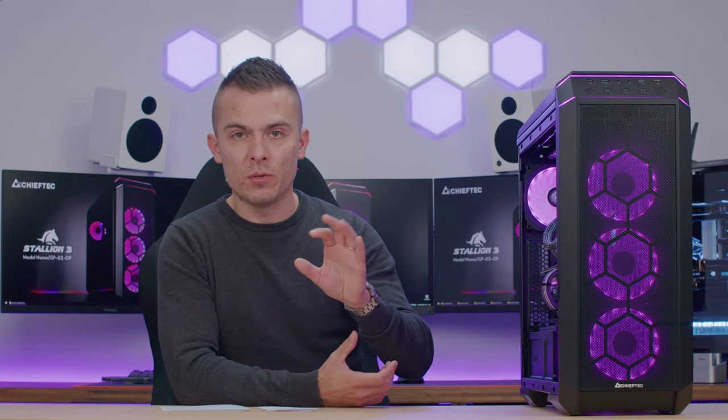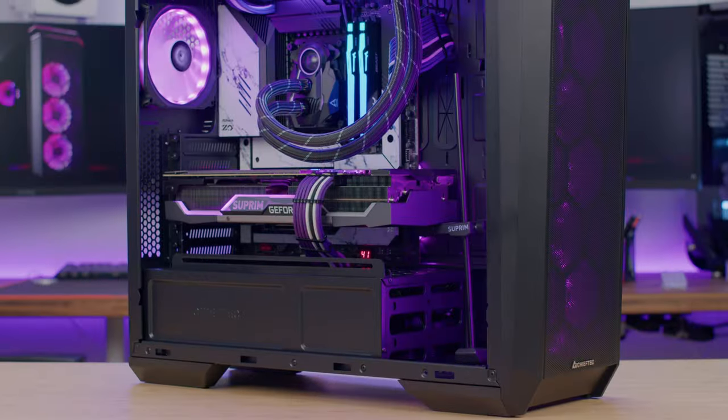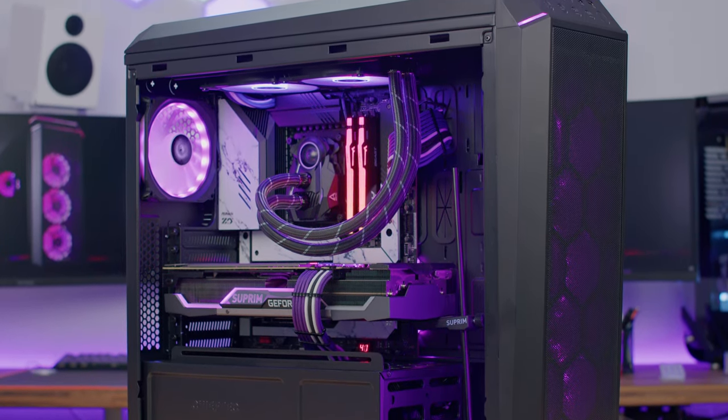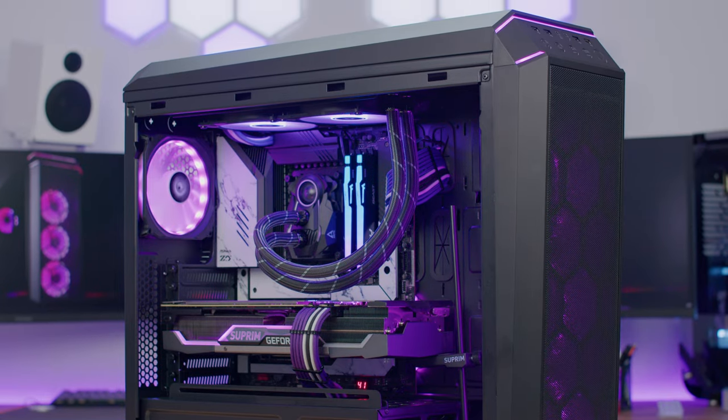And the 7900X AMD Ryzen 9, the new AM5 platform, in AIDA Extreme Edition, just with the CPU ticked, so we'll get to the other part later on, got 74 degrees Celsius. But here's the catch. When ticking CPU, FPU, cache and system memory, the CPU went up to 79 and the GPU went to 61. Just to clarify, I do all my benches when testing cases and coolers in AIDA 64 Extreme Edition.